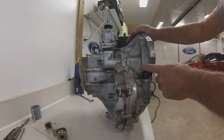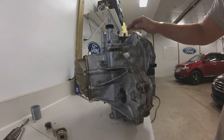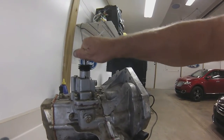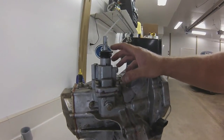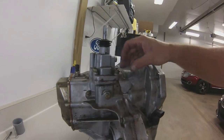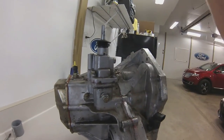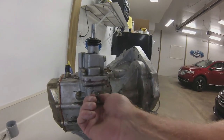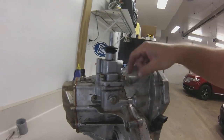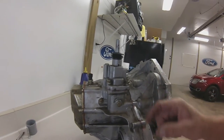Put my sensors back in — my speed sensor, your timing sensor off your flywheel. Now this is the part where I was saying I had a problem with the shifter binding, and that was in its up and down movement — it was really hard to do before. But if this were mounted in the machine, you have one bolt that goes through for your bracket, three bolts around here, and this pin holds this shaft and that cover from coming off. Technically you could take the whole thing out if it were binding and clean that lower shaft, just by taking out the nut that goes into the H-pattern within the shift mechanism — taking these screws off, this whole cover should be able to come up out of there. Then you can take this out, tear the whole thing down, and sand and clean that shaft.